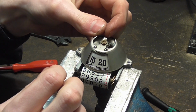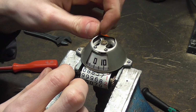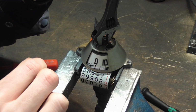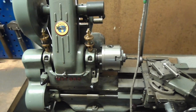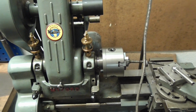Now what you do is rotate around this piece of sheet here. Tighten the nut again. And then retry. You don't really need a lathe to test this. A drill will do fine as long as you know which RPM it runs at.